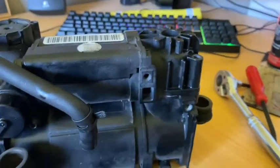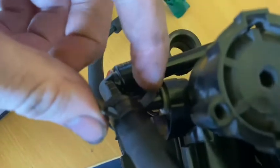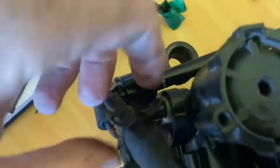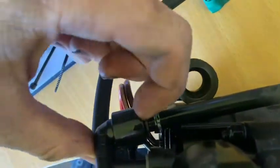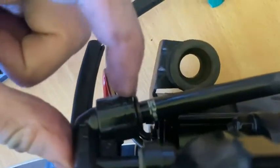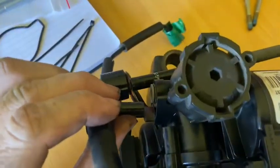While I was separating the head from the cylinder, a quick pro tip I just learned on YouTube — passing it on: don't try and pry this out with a screwdriver. What you do is push that little gray ring in, then pull this out. Same on this one here — push that in and then pull that out gently. I just left that part and haven't touched that side. So let's get this undone.